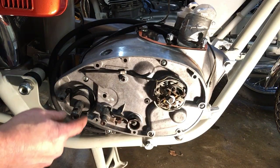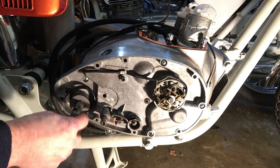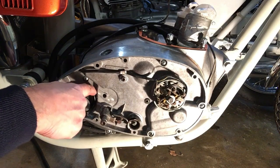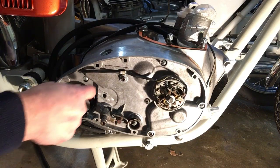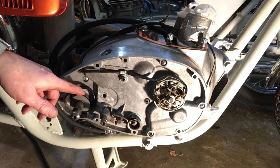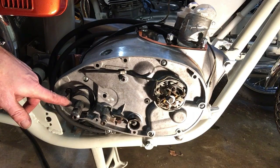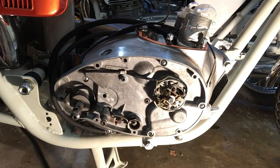The biggest problem that you have with this is not the tension of the spring itself. That's not bad. It's actually the fact that as you're twisting the plate round to go onto the kickstart shaft, the top ring of the spring gets caught in between the shaft stub on the case and the plate. So you're continually trying to maneuver it out of the way so you can press the plate on. But with a bit of jiggery pokery, it's possible, and it's now on.